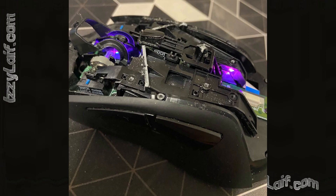All other advice that you may find online somehow relates to cleaning or even replacing the encoder assembly that is responsible for receiving data from the scroll wheel. Logitech used to have optical encoders in the past, but nowadays most Logitech mice come with physical encoders, and those physical contacts are prone to oxidation, especially if you live in a damp climate or your hands are very sweaty and the sweat enters the insides of the mouse.